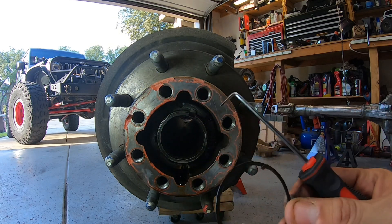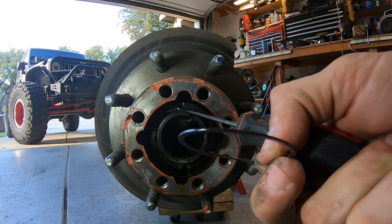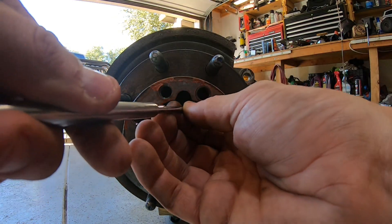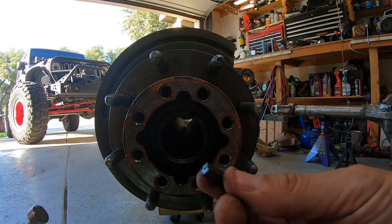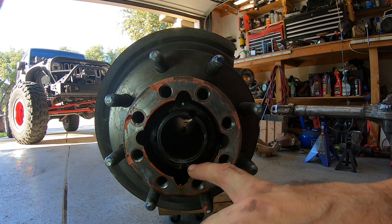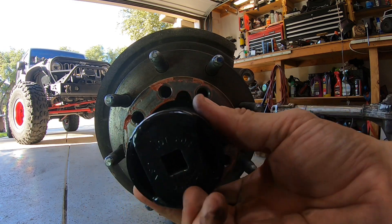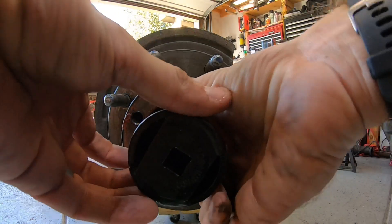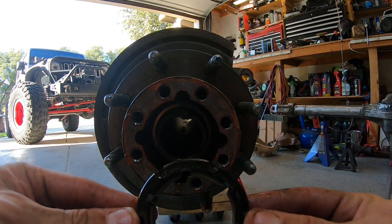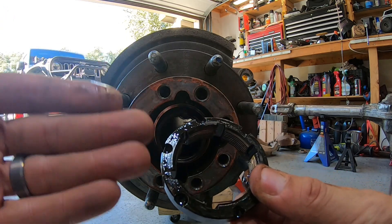That spring is a lock, and its sole purpose is to hold a magnet in there so that the nut on the end of the spindle can't loosen, because it's not that tight. Now we're going to use our magnet to retrieve that little magnetic block. Don't lose it because you're going to reuse that spring and the little magnet that secures it. You can see this nut has all these little notches cut out in it — that's where all the teeth on the socket are going to sit, so it fits perfectly. You can just spin the nut out by hand — we literally did that by hand off of a one-ton axle.